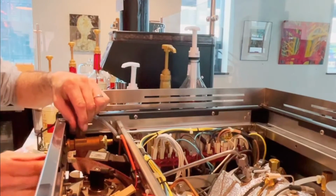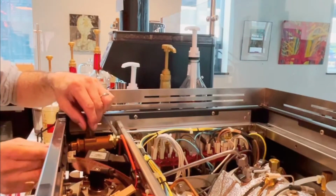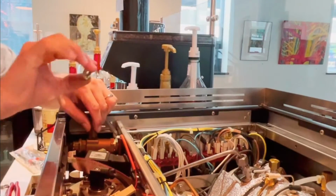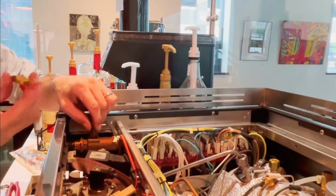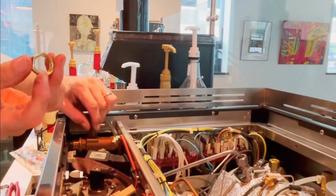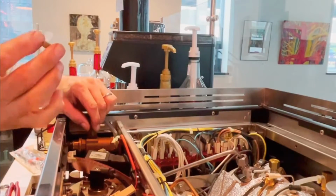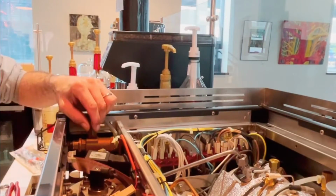And we are just about free here. There's the nut, and there is a right side and a wrong side. The face that goes to the frame of the machine has a very skinny rail. There's a wide surface and a skinny. The skinny goes to the machine.